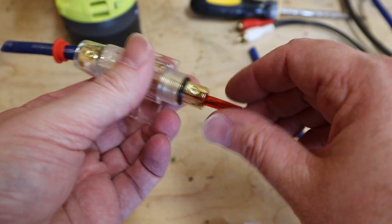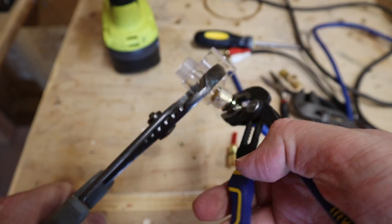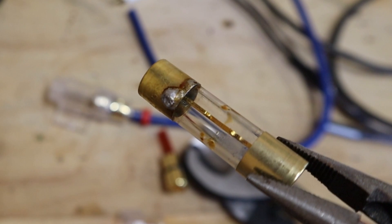Let's take this apart and look at the fuse. The unaltered side is just fine — nothing burned or damaged. The threads on the other side appear to have melted together, and the fuse falls right out because I removed the clip. You can see the burn marks and that little drop of solder at the bottom of the fuse. I had to use pliers to separate the metal from the melted plastic. We didn't get a catastrophic failure, but what you just saw is a lot closer to what you'll experience in the real world — not a huge catastrophic failure, but a gradual incomplete failure that eventually leads to one. That's good news because you should be able to catch it before it becomes total.